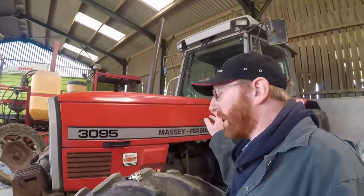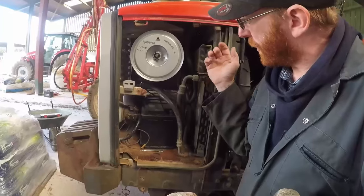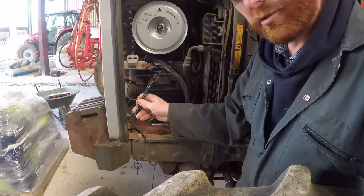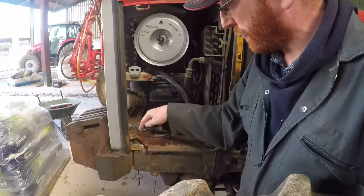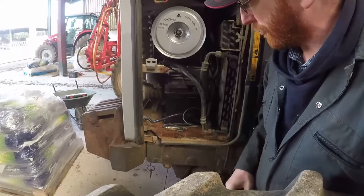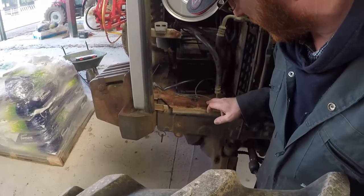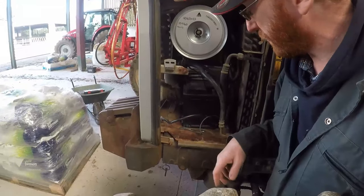Let's take the panels off and see what we're going to do. The battery on the 3000 is in the front behind the grille, in front of the radiators and below the air cleaner. The battery is always disconnected on this one and it is earthed through a mounting bolt of the front nose surround. You can see in there it's not pretty — it is rusty. The battery tray is rusty, there are some holes in it underneath the battery, and the front end is a little bit corroded.